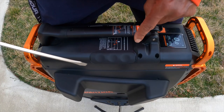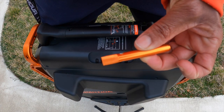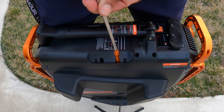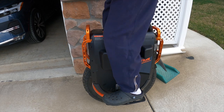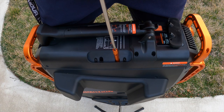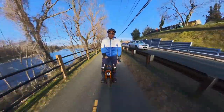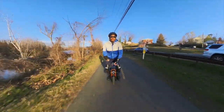Accessing the damping requires the removal of its protective cover. Then insert the damping regulator into the adjustment port. Here I use a screwdriver to adjust the regulator. Turning it clockwise will increase the rebound — as you can see, doing so there is resistance from applied force. Turning it counterclockwise will decrease it — as you can see, there's relatively no resistance. So depending on your comfort level will be indicative of how much or how little you turn in either direction. A word of caution: once there's resistance from adjusting the damping, do not force the issue or you will run the risk of damaging it.